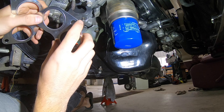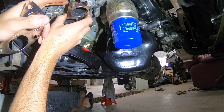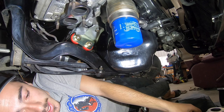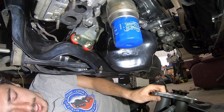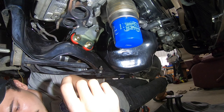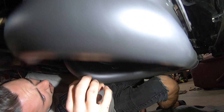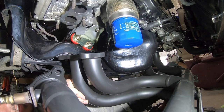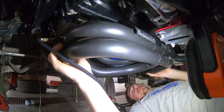First things first, we're gonna get these gaskets set onto the studs — doing both sides but I can only show one side since lighting is tough under here. The way to get the gaskets to stay is put them on at an angle until they're sitting on some threads and they'll stay. These headers are kind of heavy when you're lying on the ground lifting them over your head — definitely a bit of a struggle getting them up there.